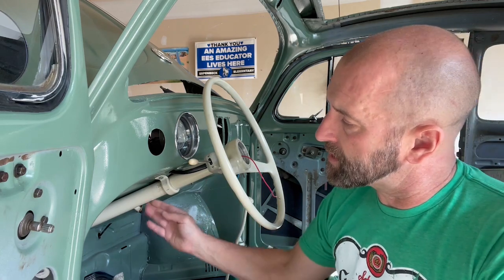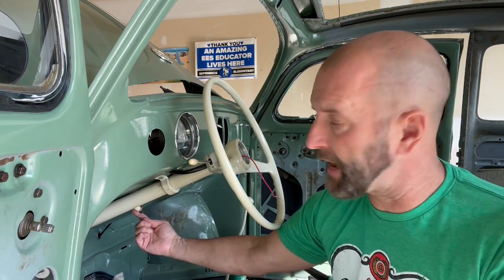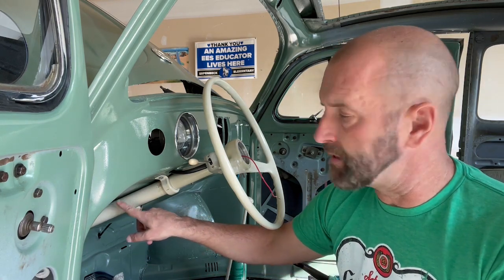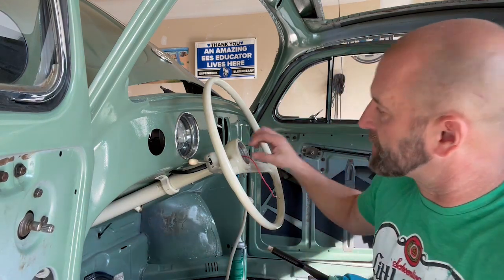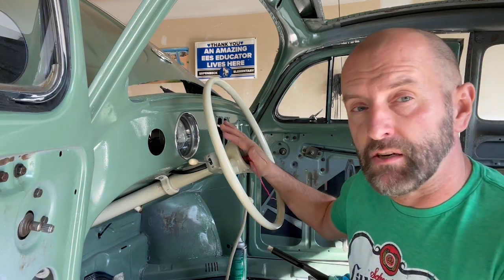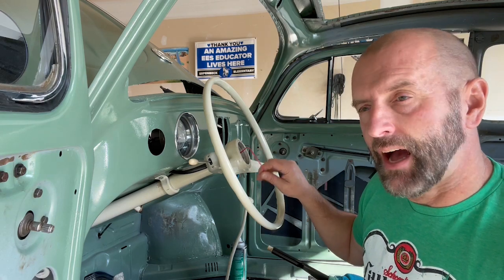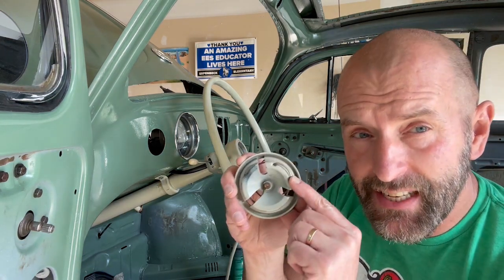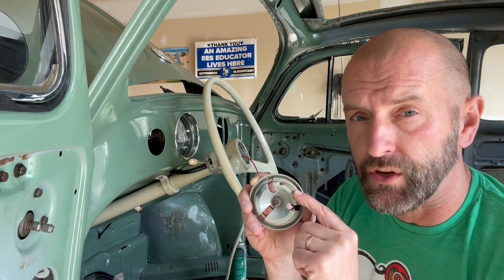This wire runs through the center here about halfway down to a commutator, and I'll talk about that in a second. There's a second commutator which is really the steering box, and you have to jump that — I'll show you that too. The challenge I had was when I replaced the steering box it changed the geometry, and this commutator with the brush was not hitting the metal band which is wrapped around and insulated on the actual steering shaft. At this point I'm in a good spot. So again, it's a grounding issue. The inside here has to be shiny, the button has to be shiny too — these things have to be super clean for you to get a good ground.